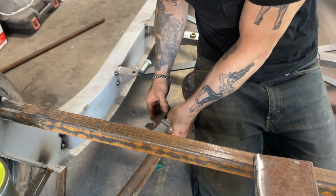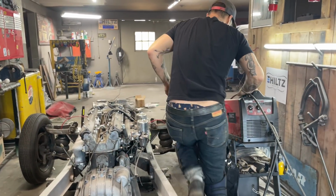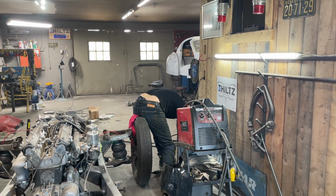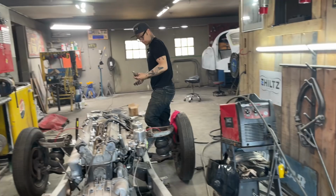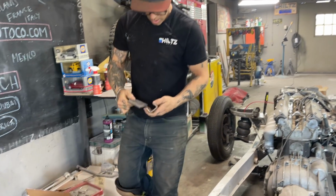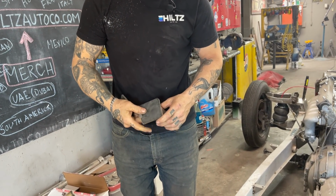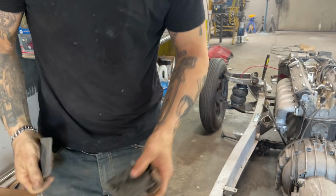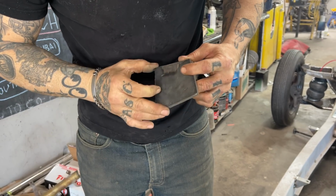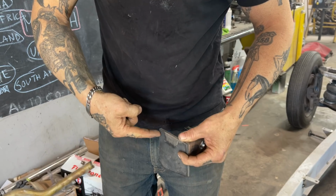And basically, this is what I need. There's some brackets over here that come with, I don't know what they come with. They're pieces of metal I got here. They're just sheared off, but they're sheared for something. Which one's not cut? If I just take this, weld that on there like that, and then 45 that up there like that, when I tack it on, it won't go anywheres.